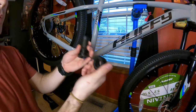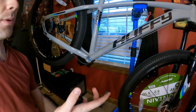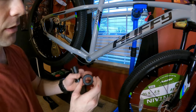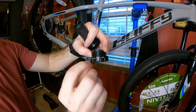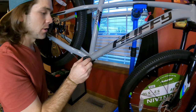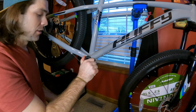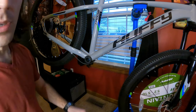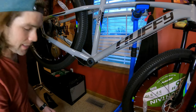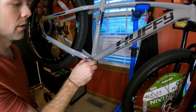Now that we have that old bottom bracket out, we can put in the new bottom bracket from the IXF set. Always, always grease your bottom bracket — it's so important. It will have L for left side, R for right side, and an arrow showing the way you have to tighten it. The right side should tighten this way, and a very important thing is it should be very, very easy to screw in — almost no resistance until you get to the end of the travel. The tool I used is a Foundation bottom bracket tool linked in the description. Now we get to actually put in the new crank set.